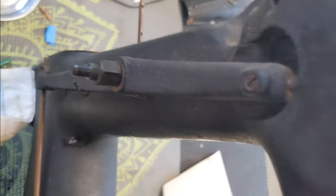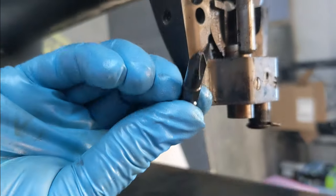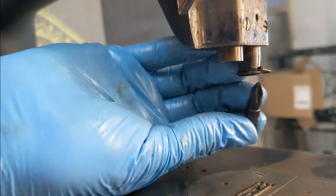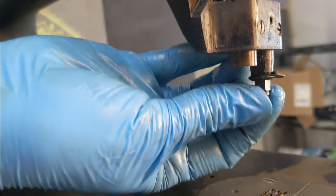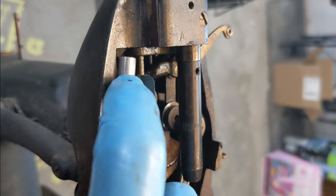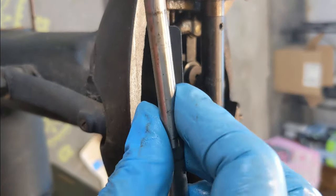So I got the needle bar out. I had to do some tapping from the bottom. I did use a Phillips head Chapman bit as a tap — just because it would fit down there. I hardly ever use these bits. I don't think I damaged it, but I was able to use that to kind of tap from the bottom to get it moved up enough. Look — there's timing marks up here at the top. So that's good. When I get to the point that I'm putting it back and trying to time the machine, I'm hopeful that that's going to go well.